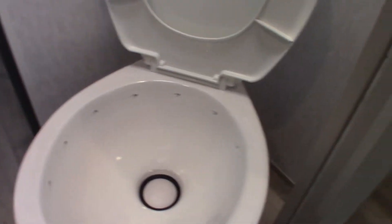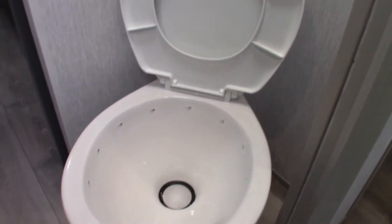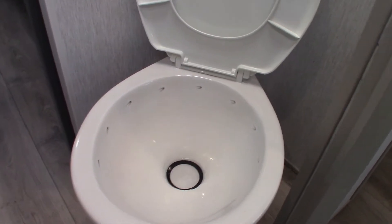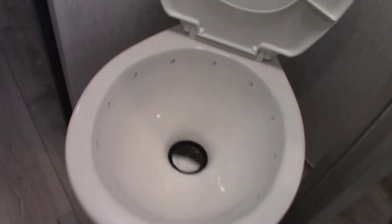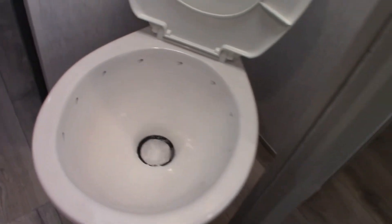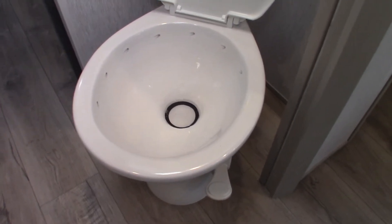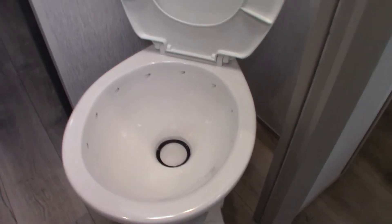The shower works like any other shower, the sink like any other sink. There's a fan, of course. When it comes to your toilet, it works like every other RV toilet — there's a flush pedal and the black tank is directly below. You can't use it dry. After you plug in your trailer and hook up your water and power, put a dose of chemical in the bowl, then step on the pedal and let a gallon or so of water go into the black tank along with the chemical. Then you're set to use it. The smell will be terrible if you use it dry, and it can get clogged. Always have chemical and water in it before you start using it — never use it with a dry black tank.